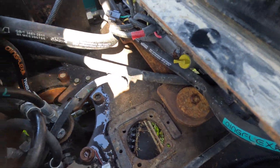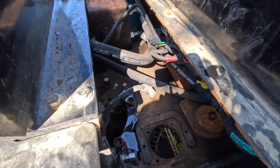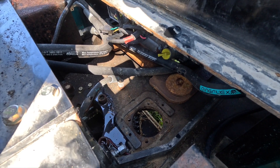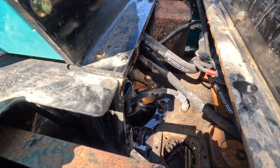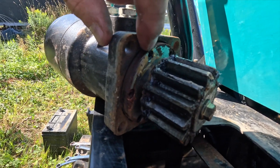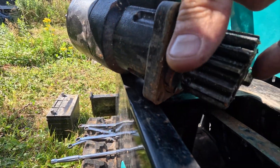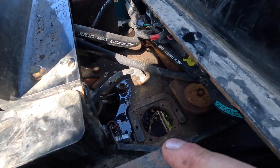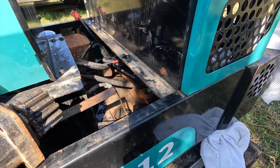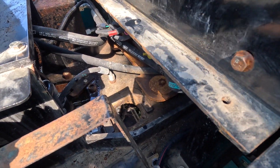Just a few minutes later — voilà — we've got a big hole in the floor and here is the swing motor. Those four bolts came out with my fingers pretty much, so they were working loose just as everybody in the groups suggested. I'm going to clean that up really good and put them in nice and tight with thread locker. I had to take the battery out to get at this — it's pretty tight in here.